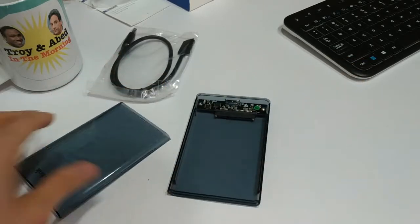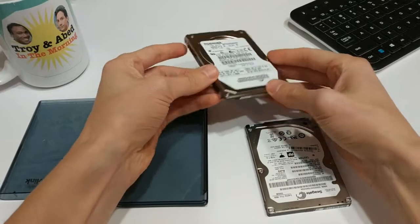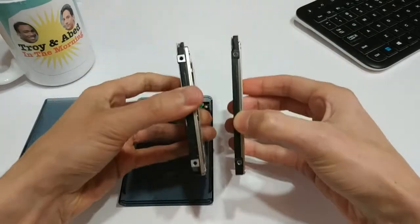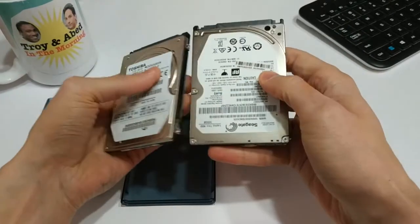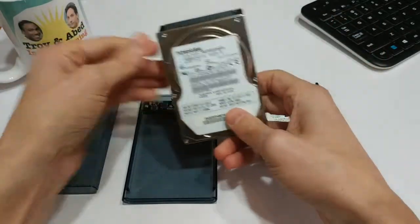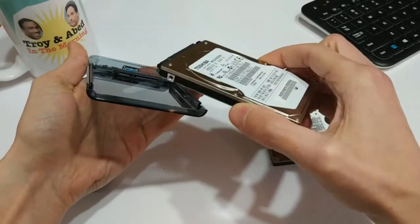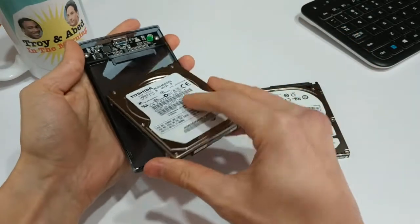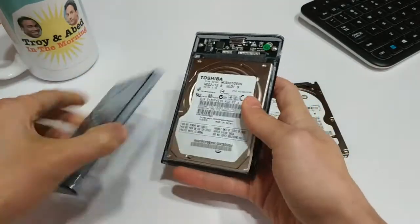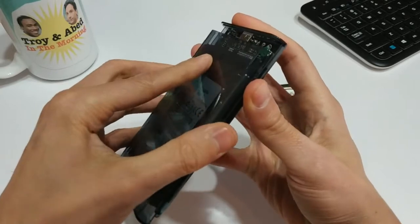Let me grab a hard drive and we'll slide it in there and see how it fits. So as you can see, I've got two different hard drives in front of me — they're both 2.5 inch, so they both came out of laptops. One is a 9mm, so it's the thicker one, and one's a 7mm. You can kind of see the difference just slightly. So let's try taking the thicker one — I think that's a 9mm one. We've got the connector, so it's just going to slide in this way. If I just push this forward — yep, it's in. Now let's put this back on, hopefully without breaking it.